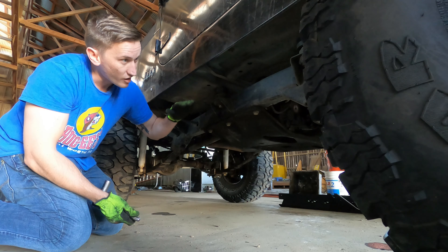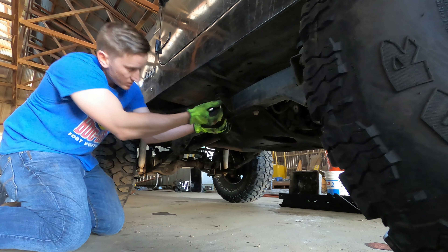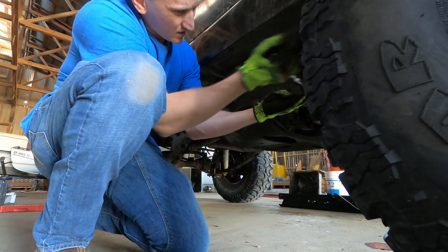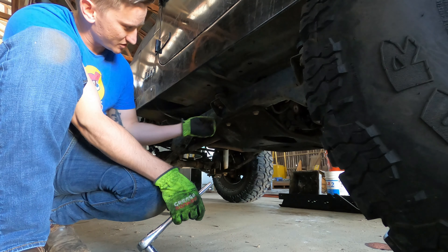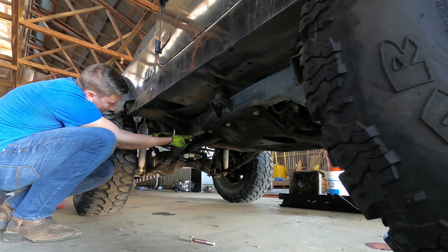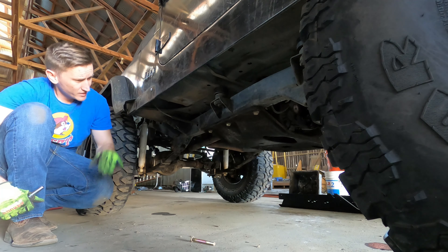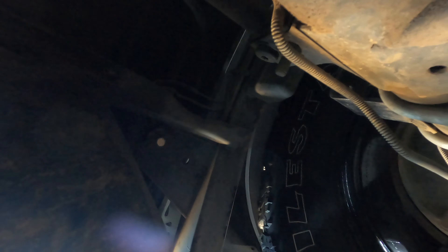I did this not too long ago with the body lift, so these are pretty easy to take off. If you've never had this off before, it might be a lot more difficult — the original bolts I took out were pretty rusty. We're only going to lift the tub up a little bit, so only this front bolt really has to come out. The other ones are just loose but still in there to hold the tub. There's one more in the back, kind of by the gas tank, and I'm going to do the other side as well so it has freedom to move.